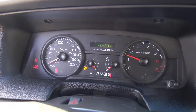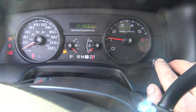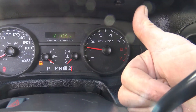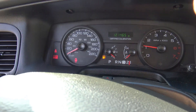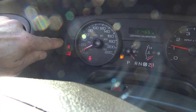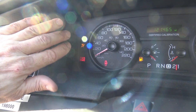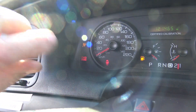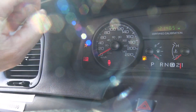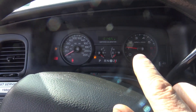I've started the car and you can see this one has 195,480 kilometers — because we're up here in Canada — but I can switch that to miles by pressing the little button, and we have 121,000 miles on this vehicle. There are no engine lights, which is good. There were no unusual clunky or thumping noises at all, but there is the airbag light — that's annoying. You can see it's on now constantly. When you first start up the car it flashes: one flash, a pause, and then eight more flashes. That means it's a code, and the code for the airbag light malfunction is 18. Now if you know your codes, you know that that is possibly a lamp malfunction — there's a lamp that lights up to indicate whether the passenger side airbag is on or off depending on if someone is sitting in the seat.